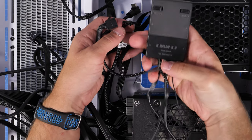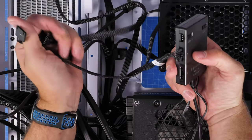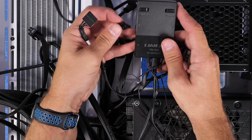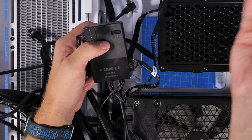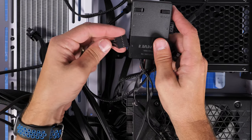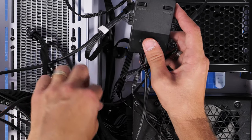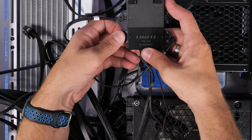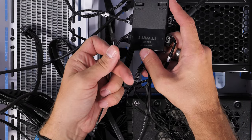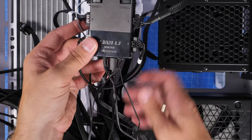This control box has the ability to connect up to four groups of fans with up to 16 fans total — four fans per group. I've got that set up in groups of three for the most part and then that single one at the back. It is worth noting that you have the option with the one group on the radiator to use the cable that comes with the single fan — it has two connections: an RGB connection and a power connection. You can connect the power connection up to the CPU fan header or to the pump on the cooler itself, and then use the RGB connection connected up to the controller.